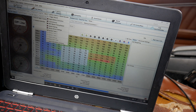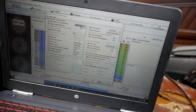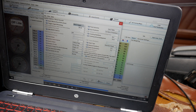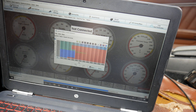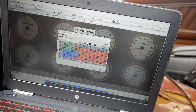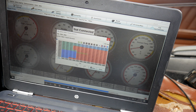Next over is the ignition table. I'll show you guys these — I have not touched any of them, but I'm sure they're all important. This is basically for the CAS and when you're supposed to get your ignition coil firing to what cylinder. For the ignition table, this is yet again one I copied online — someone else suggested it who was running a similar setup and said it ran great. I don't have any knocking, I haven't had any crazy backfires, so the spark advance is pretty decent right now. Feel free to copy that as well.